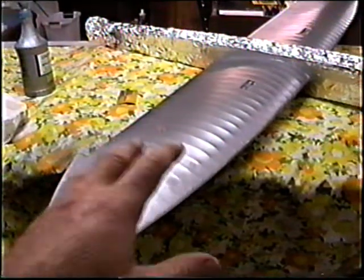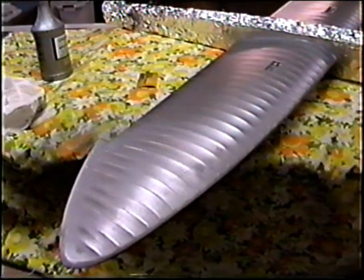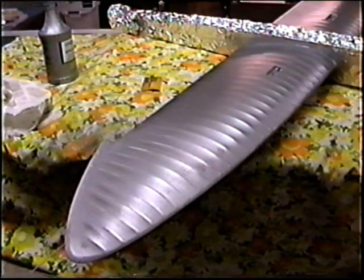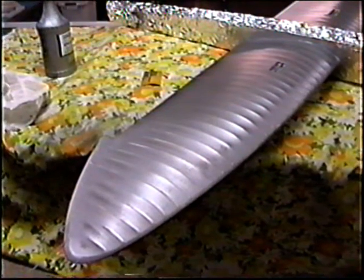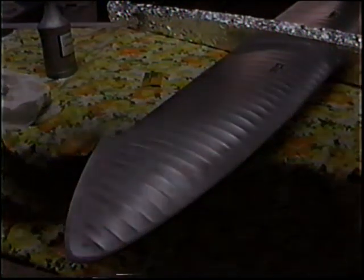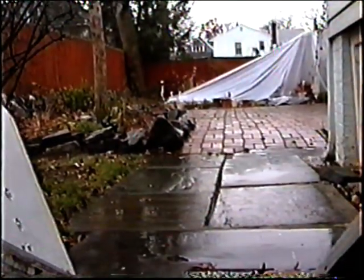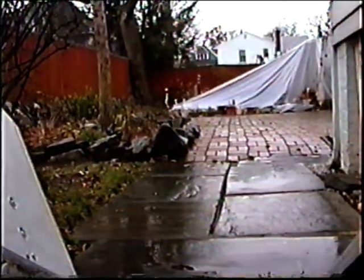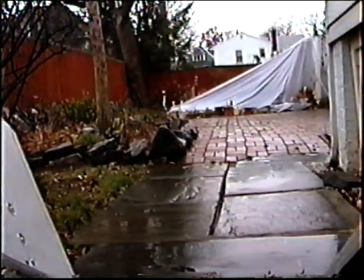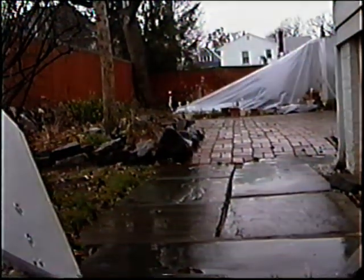I just wanted to get it started, and I really wanted to see just how long it would take before this dope was sandable. And I think 9 hours is, well, it's sanding, 1200 and 600. And I'll finish it up tomorrow. Now it's raining all day today, and obviously we're not going to spray. But even if we had this sanded out, this is the kind of day you just wait for another day, especially when doing silver. So I'm going to try to get down there and see if I can get that sanding at least finished today.